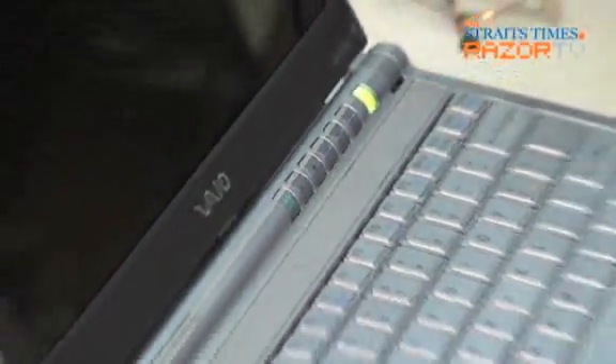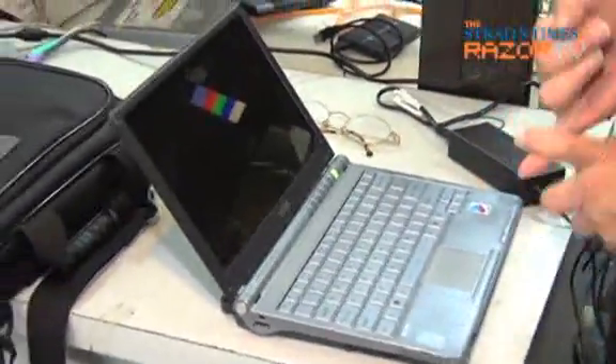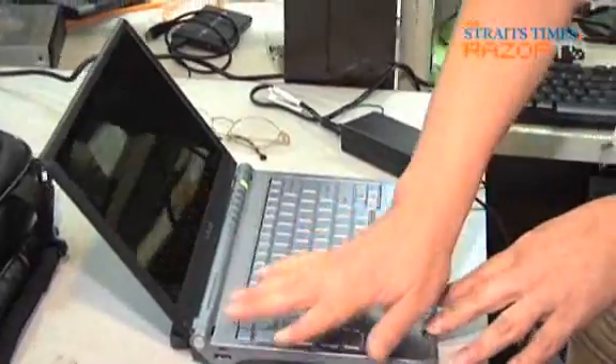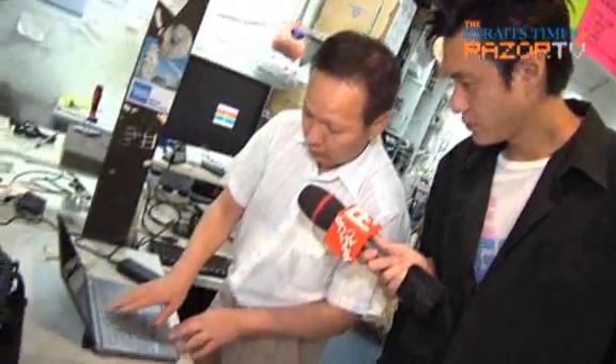To display anything, the first step is to check the RAM — whether the RAM is faulty, or the motherboard. If the RAM check comes back OK, then 90% of the problem is related to the mainboard already. We need to check whether the mainboard is OK or not.